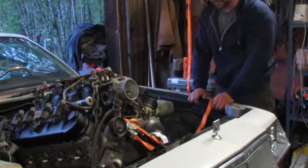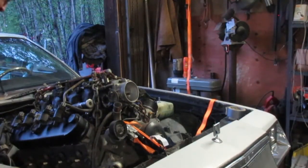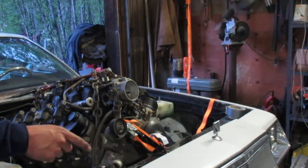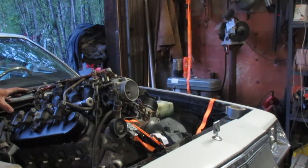For the most part, I was just kind of getting an idea of how high this thing is going to sit. I think the springs that I opted for in the suspension kit, they're maybe a 1.5 or 2 inch drop, but that was with a small block Chevy first gen, which is heavier than this LS motor. I may have to pull the springs and swap them out in order to have the front ride height correct.